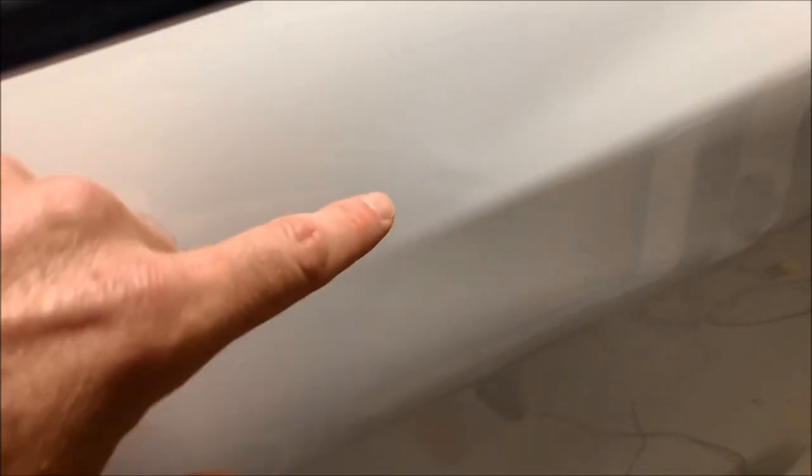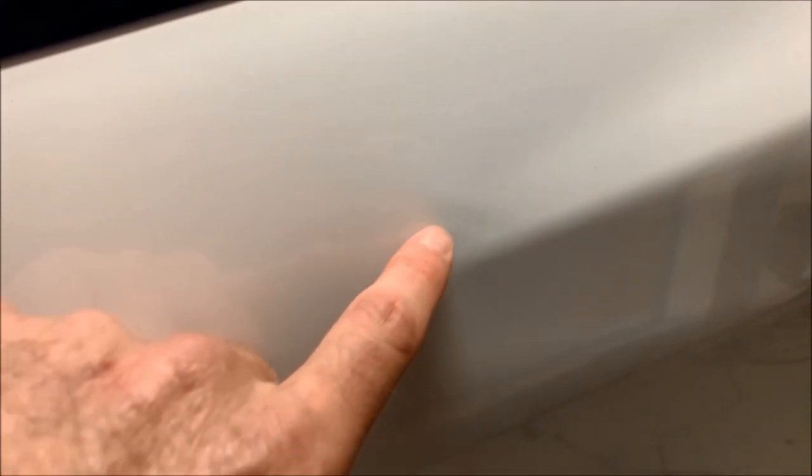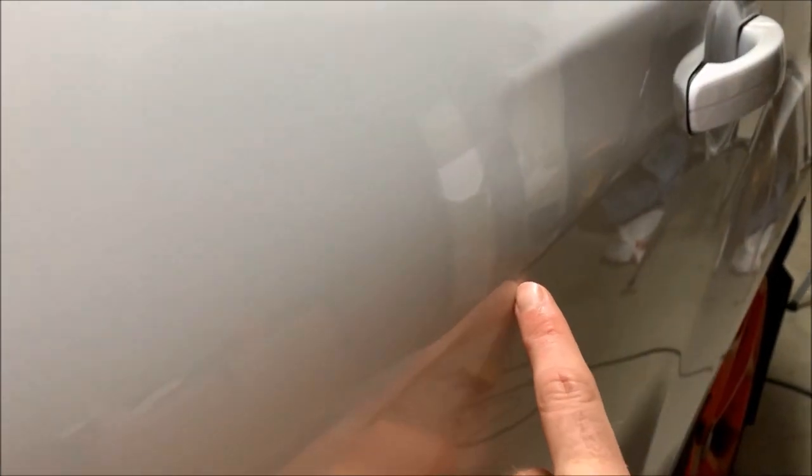After using the knockdown tool and then the dent puller right behind it every single time, this is the best I could do. I'm extremely stoked on how well it came out. The crease itself is completely gone — there are just these little high points around it, but it's not hardly noticeable at all in person. The bottom dent actually came out really well too. If you look at the body line, it shoots straight across. There's one small low point right on the body line but I don't think I'll ever be able to get that out. Overall, I'm extremely excited — it worked out really, really well.